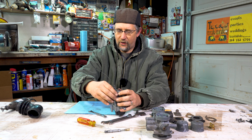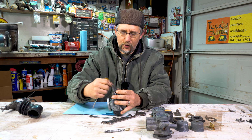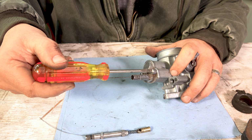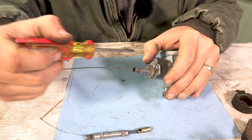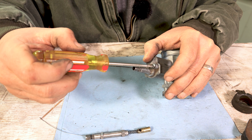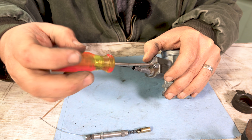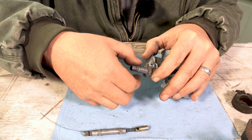All right. The other part you'll have to undo from the truck is the top of the throttle slide. And there's 2 flathead screws holding that on. So you need a flathead screwdriver. You'll undo these screws, just like that. And this also has a spring, so you're going to feel tension. You're going to feel it starting to pop up.